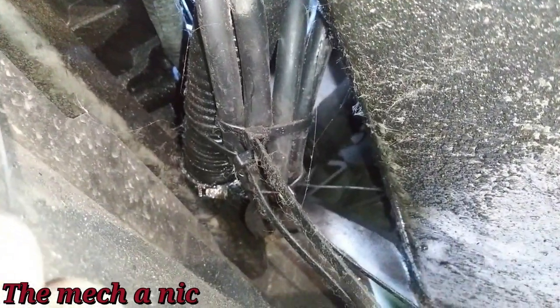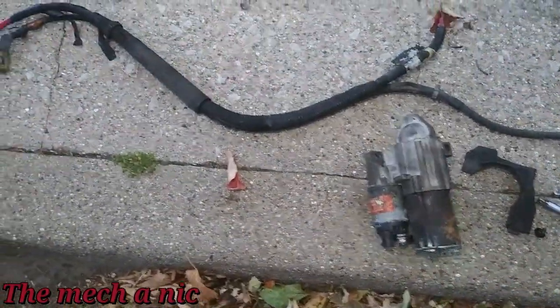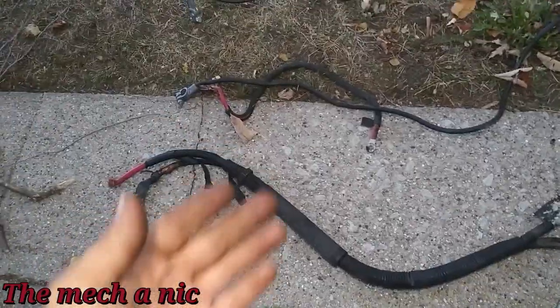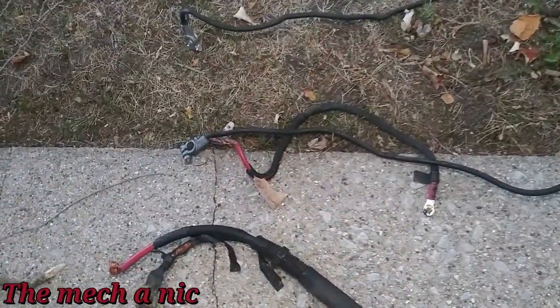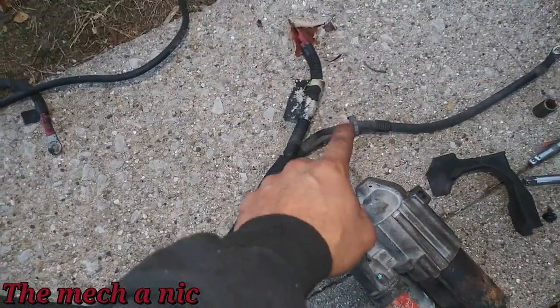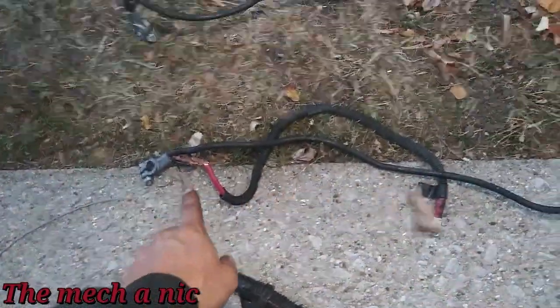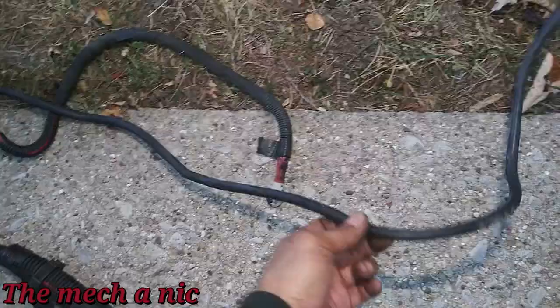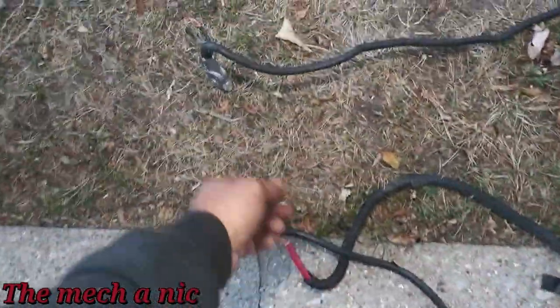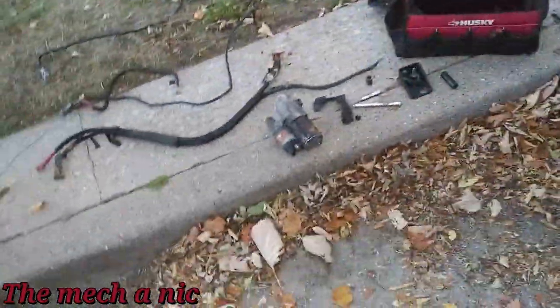If you bought the complete harness, just do the job right. Pull back the shield right here — look at all those wires bundled together and zip tied; that does not look normal. I had to remove the starter, and here are all the wires out of the car. There's the original harness with power and ground integrated into one, and then somebody ran a separate power wire and a separate ground wire. All the old stuff is now out.